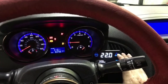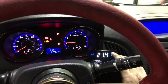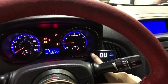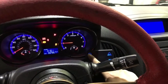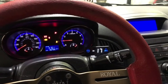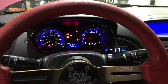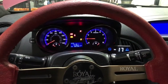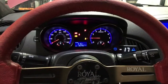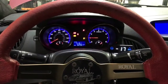This setting here is over-boost. You can actually set your over-boost PSI — let's say we set it at 21. When it hits 21 PSI it will open the wastegate for you. So if your target boost is around 19 to 20 PSI and you want to stay safe, you set the over-boost one to two PSI higher, and it will make sure your car doesn't over-boost and have a catastrophic failure like this car did.